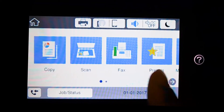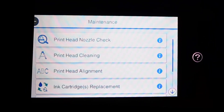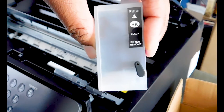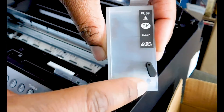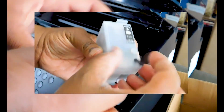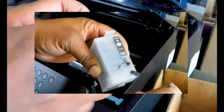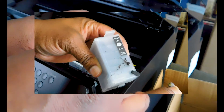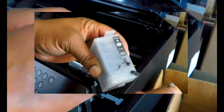You're going to use the settings menu to start the process of replacing the cartridges. When installing the inks into the printer, make sure the matching color plug is in the injecting hole and that you leave the air hole on the bottom unplugged. I had both holes plugged after filling to prevent spilling because I'm clumsy and I was filming — I would not recommend this. With both holes plugged, the air pressure built up in the cartridge and it sprayed ink when I unplugged it. I would recommend that you fill the cartridge and install them right away into the printer.